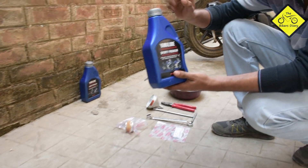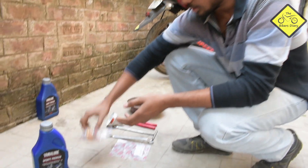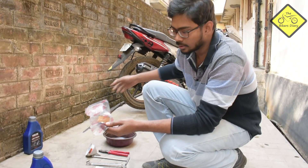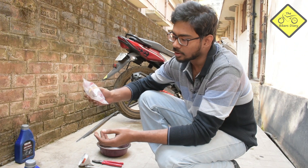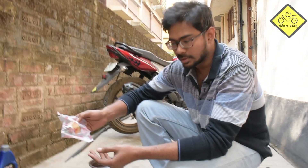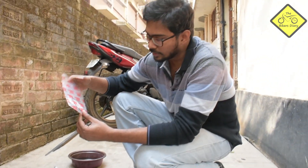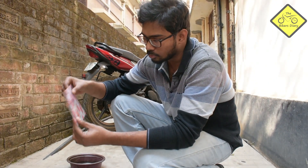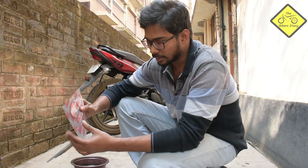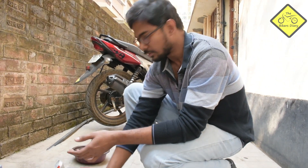First you need this engine oil which I use in my motorcycle. This is the oil filter — it helps run cleaner oil to your engine head, which is why this filter is very important. The company recommends a change interval of 10,000 km, but I suggest you do it every 5,000 km or so. This is the filter O-ring, which I will demonstrate how to use and why it is needed. It is basically a gasket that prevents oil from escaping through those vents and prohibits leaks.